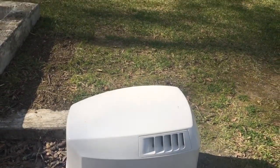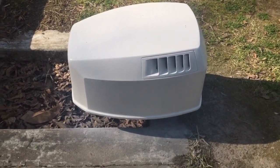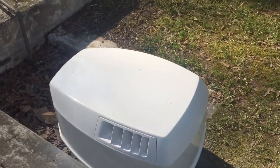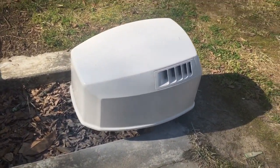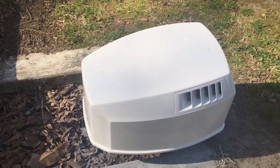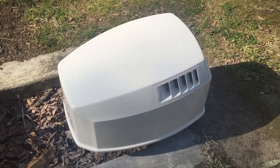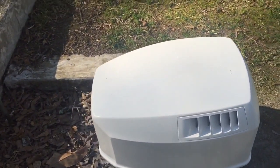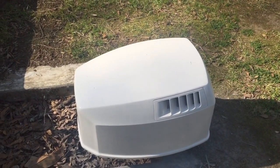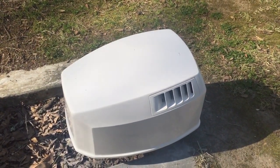This is three coats and you can see I'm doing this outside - this is obviously an amateur paint job. I got pieces of dirt falling on top of the paint so I'll have to use tweezers to get that off. I did some research online and most people said go ahead and put your clear coat on prior to your base coat fully curing - once it's dry to the touch you can spray your clear on, and that's the proper way to bond the paint. I'm gonna put probably three coats of clear on there.